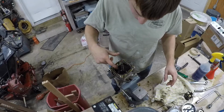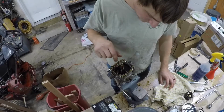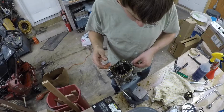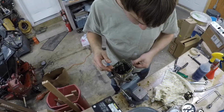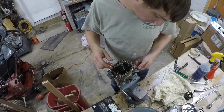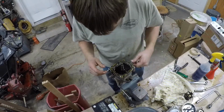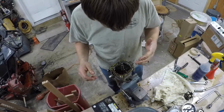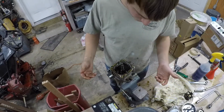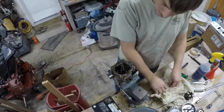So down in this pool of goo is a spring and a washer on this input shaft. Then there's a thrust bearing under that that's on a swash plate underneath that that's connected to this, I guess it's the actuator, swash plate, I don't know. It's what connects to the handle on the mower. You do this and it either puts hydraulic oil to the front or the back of the wheel motor, so it goes forwards or backwards.